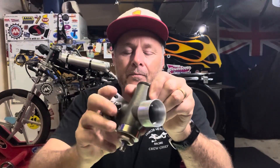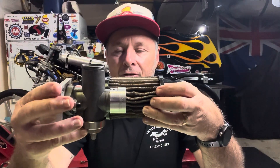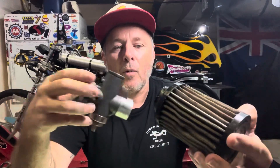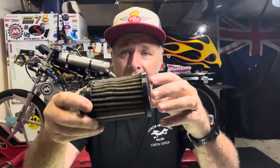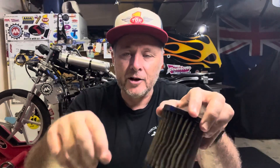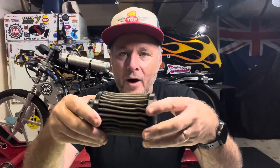It's about as short as we can go with a tapered bolt to hold the carburettor on - 7mm, that inlet manifold, so that's pretty short. On the other end we have a tapered inlet that rolls through to the carburettor. The reason I put that on and machined the carburettor lip off is that I wanted to get the inlet inside the K&N filter, past the rubber edge and the step in the K&N, so it's getting clean air. I've had people tell me the air will be dirty coming through the K&N but I think it's still and it's a nice open area to keep the salt, dust, and dirt out. So that's worked pretty well, and as you can see it's pretty clean through there.